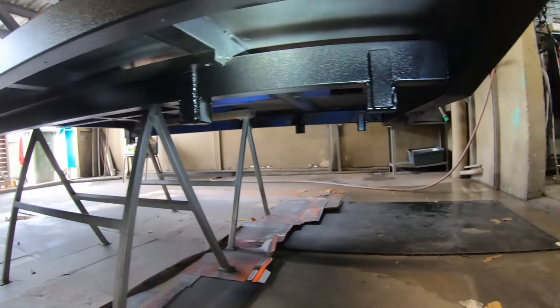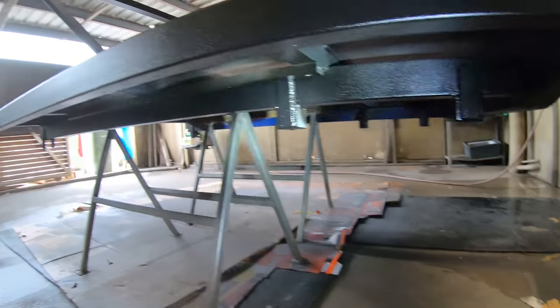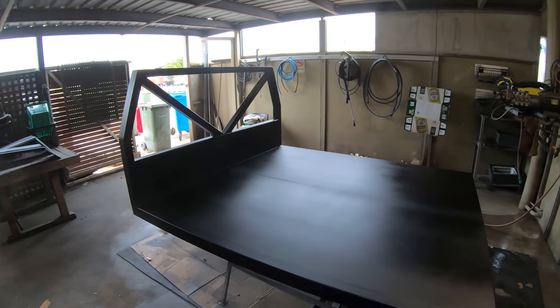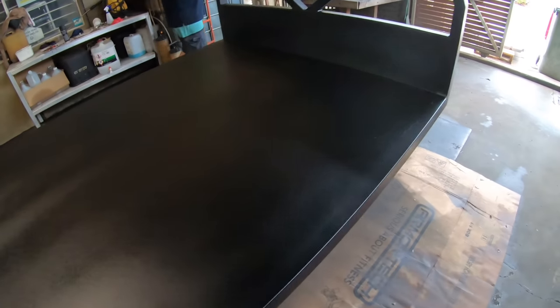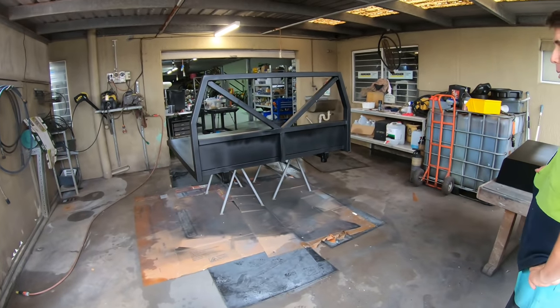And we got the chassis rail done, just on the outer edge, and all the mounts done. So we didn't get really underneath, but our plan is to get a blanket, lay it on its headboard at one point, flip it upside down and just go to town with some rattle cans underneath. But the main thing is the 4 litres of Raptor covered the whole tray. So if you're wondering, you're building a 2 metre tray, 4 litres of Raptor on the dot, eh? At least, yeah. Even a bit more would have been nice.